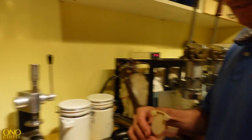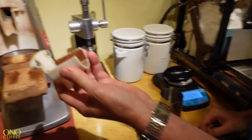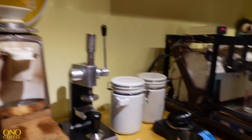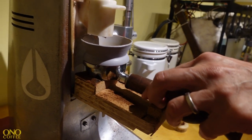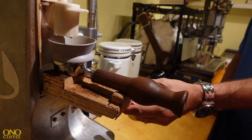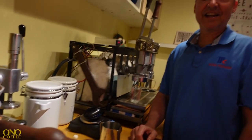You've made modifications to the Mazzer as well? Yes, with 3D printing. I made my own funnel — you take this off so you can sweep the grounds out of the funnel shape. I've customized this with a piece of cork glued and taped on to prevent fines from going everywhere. There are magnets here and magnets on the underside, so it just clicks together. With the funnel and a little landing pad, it just perches there while it grinds. The landing pad is cork-covered plywood.